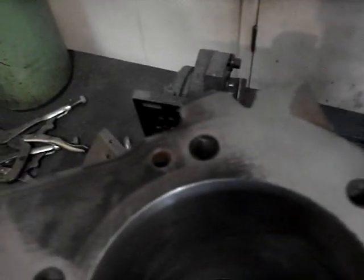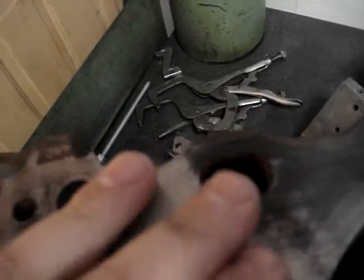We're having issues with the block sinking here, and the reason is simply because that's where all the heat is — that's the exhaust side. Come back here, looks like it's cleaning up pretty nicely down there. We got a low spot here, we got a low spot here. Come up here — we actually have a little bit of a low spot here too.